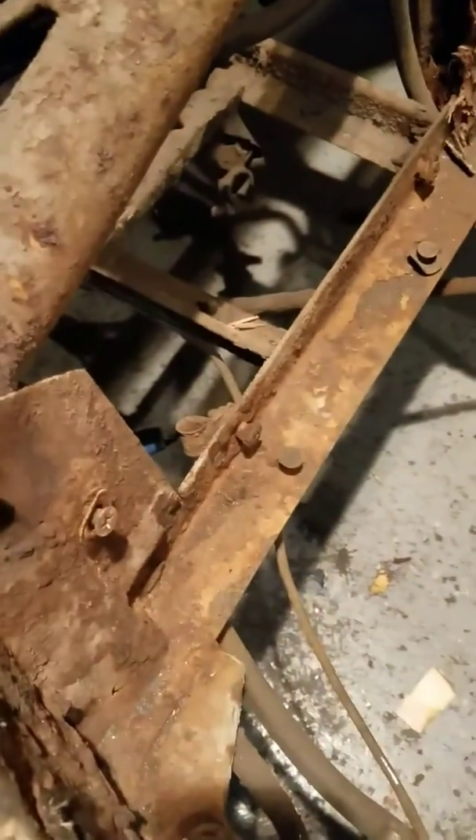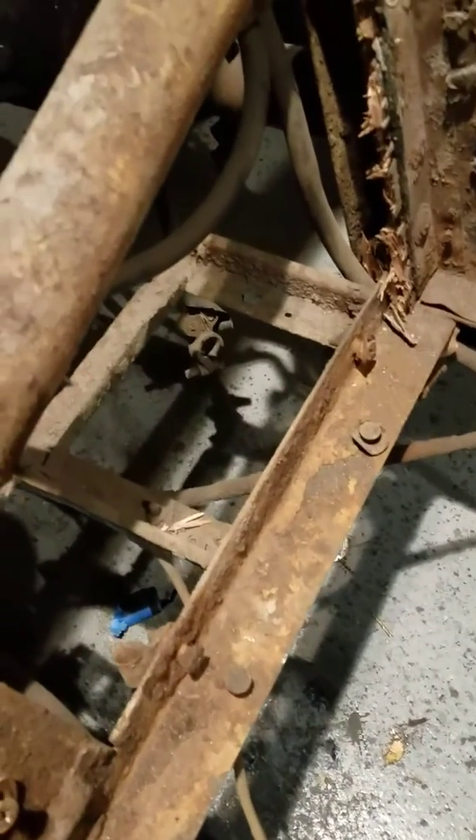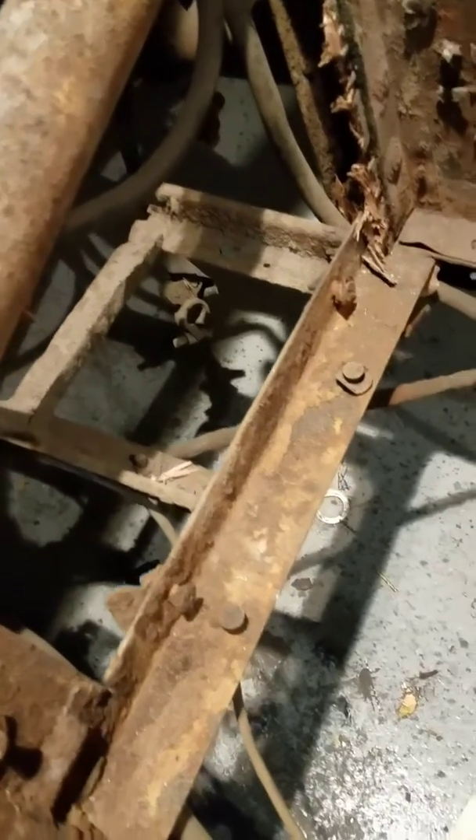For the remaining stuck bolts, I'm going to cut them off with a sawzall or an angle grinder, drill them out and call it a day. I've got some thread keepers and thread restorers so I may be able to reuse those threads. If not, then cut the entire thing out and put new inserts in later on.